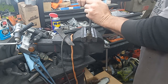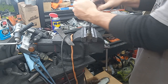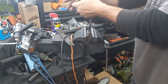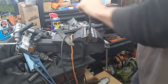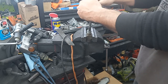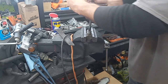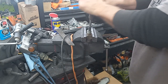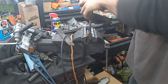I like trying to stay as centered as I can. I like going a few threads and then I like to back-cut it, because you can feel it cut the chip right off — that way you know you don't bind your tap up. It's a straight-through so I should be able to get all the way through.